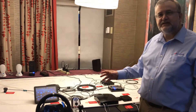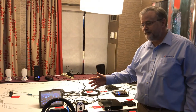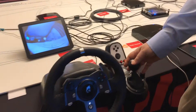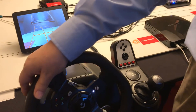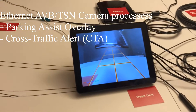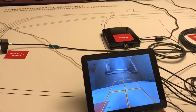So let's take a look at some of the functionality of the system as it's now configured. On the head unit we can see our forward camera, we can see our rear view camera, and we have a parking assist overlay. This is processed in the camera itself and presented as a single image for display rendering on the head unit.